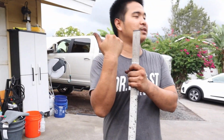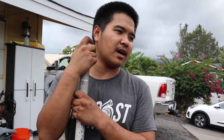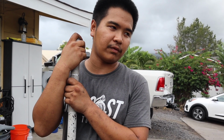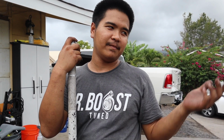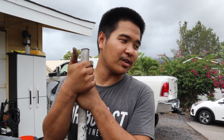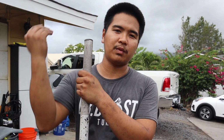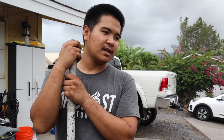So we ended up having to replace the starter. We took the starter off my car and put it on Jalen's car. After that, the car cranked over but didn't want to start, and it was starving for fuel. So we took the fuel pump out of her car, put my fuel pump in her car, and she's a runner. She's a freaking runner. So now we have to get a starter and a replacement 255 Walbro, because obviously the one we got from B&M Performance didn't really work.